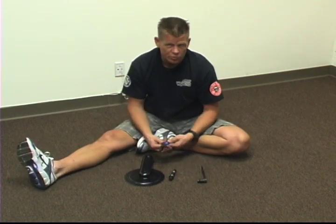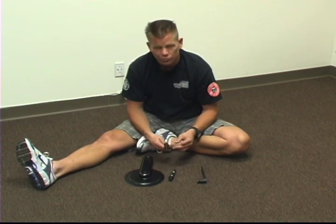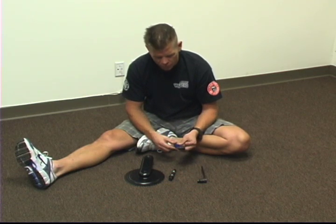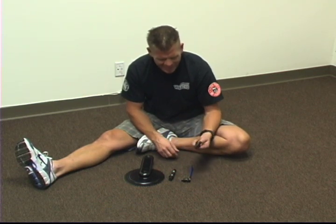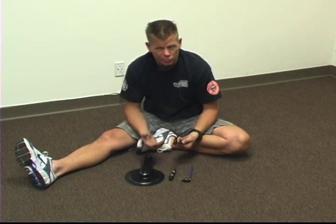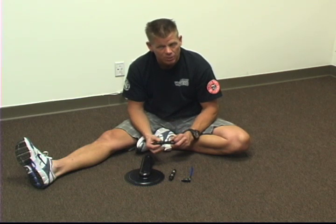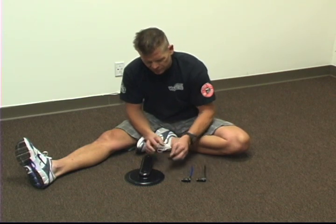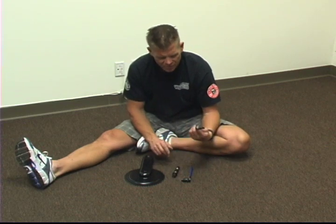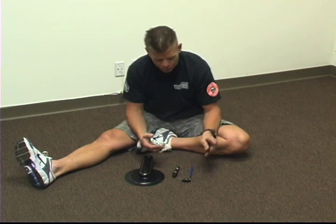Park is a bicycle tool company. Most bicycle shops will use Park tools. Most of the Park tools have blue plastic coating. They're commercial grade tools. The black Park tool is made specifically for new technology bottom brackets that use what's called ISIS spline technology, and the spindle is a different configuration or size, so you have to use a specific tool for it, and that's typically a black tool.